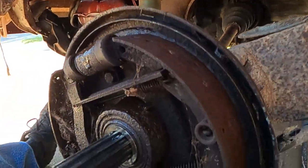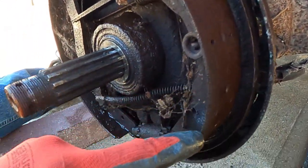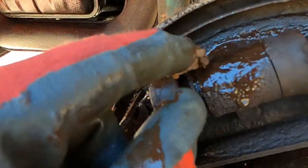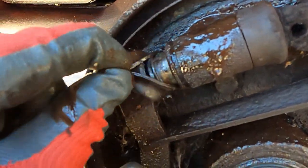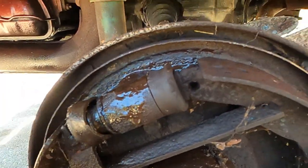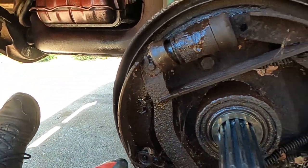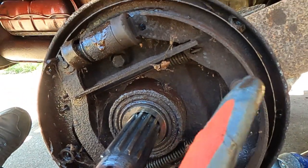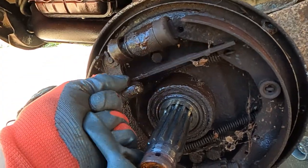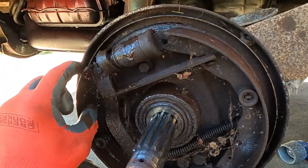It's a little bit dark, but I think you can see this is where the brake liners go. Apparently been sitting a little bit too long, and this would be the cause of our leak. This whole wheel cylinder just sort of expanded and blew out. So at least we know we're getting pressure there. So it looks like we need a brake job. We're gonna spray all this stuff down, take her apart, and put her back together. Fun. I hate drum brakes.